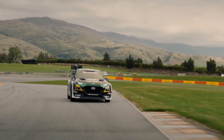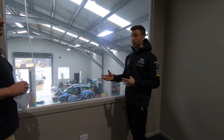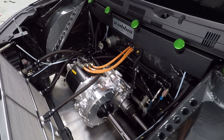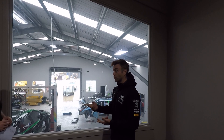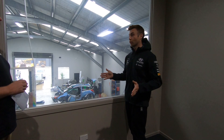We've designed this based on a rally car. It's running two motors, and we can put four motors on it — each motor has a capability of up to 200 kilowatts peak power, so with all four motors it's 800 kilowatts. But that form of EV motorsport already exists — there's already rallycross cars, hill climb cars that do Pikes Peak. Our point of difference is a rally car and making it work over a long period of time.